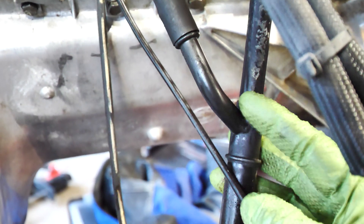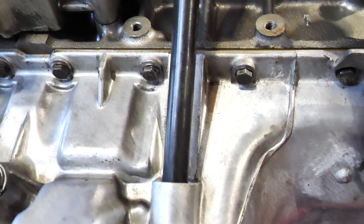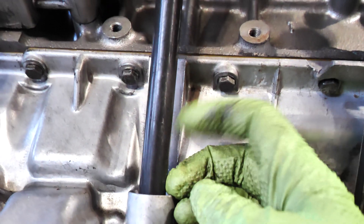This return line goes into the oil pan - I'm going to cut this piece off with a band saw, then modify this tube. The tube before was coming in right around here, so we'll do the same sort of situation: mark the tube, drill a hole, put a bunch of grease on there so it doesn't get too bad, clean it out afterwards. I don't want to use brake cleaner because that's bad when you're welding - makes poisonous gas. I think this little spot right here is pretty good, so using a center punch to punch a pilot hole, then drilling a 9/16th hole.